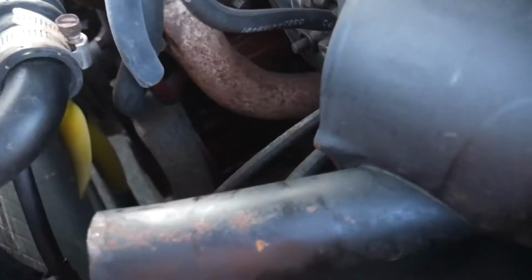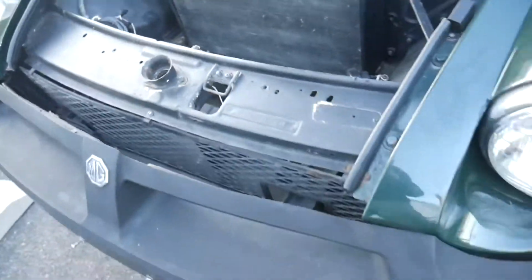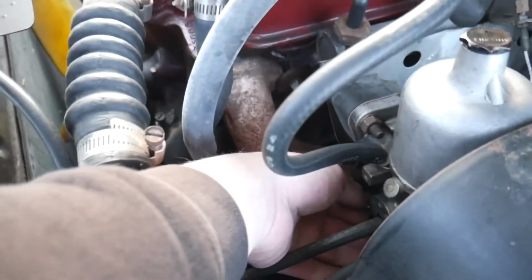So I was just looking over the whole entire car to look for any leaks, and I found one right here up front, and I see it kind of leaking down off the steering, which is weird. It's a very weird spot. There's no coolant in it. There's no fuel lines that run to the front over there. That is really weird. Oh yeah, that is gas. Jeez. Ooh, maybe the carbs are leaking. Could that be it? Oh, looks like it might be.